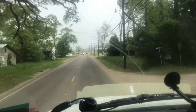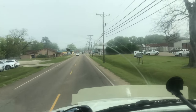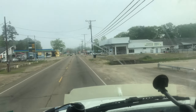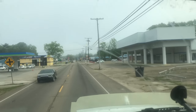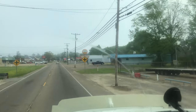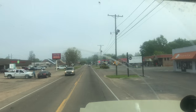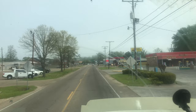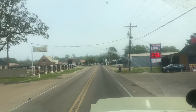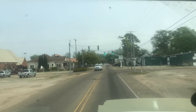This is very important — here's what you need to get out of the rest of this video. My intersection is about a mile away; I can see the red light up ahead. The third axle takes anywhere from five to ten seconds to come up off the ground. So I'm going to wait, wait, wait — I'll get past this chicken place and go ahead and let it up. Now I'm letting my third axle up because I know it takes five to ten seconds to come all the way up. If I had to brake before it's fully up, that tire is still going to be partially on the ground and it's going to skid.